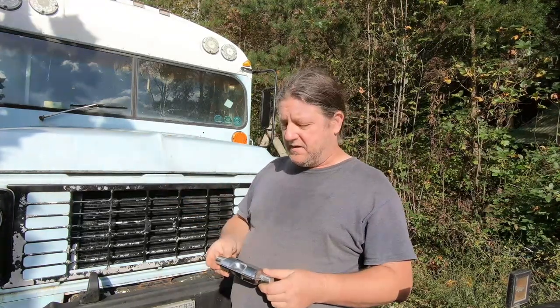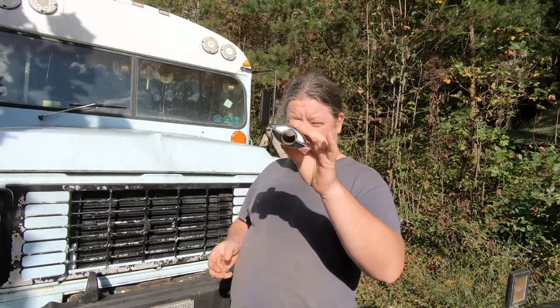You may have noticed that was just a straight pipe coming off the diesel heater to the outside of the bus. They come with these little mufflers, and my best advice on what to do with them is to get rid of it. I fought some horrible issues with carbon and soot buildup last year and tracked it down — it took me a while to finally figure out what was going on, but the muffler had plugged up completely. It's not even much of a muffler. So I really don't know of any situation where it would make a difference in the sound level, but it sure does build up with carbon and restrict it. I had to take it apart and clean it a couple times. I got rid of that muffler, went to a straight pipe, and I've had zero issues ever since.